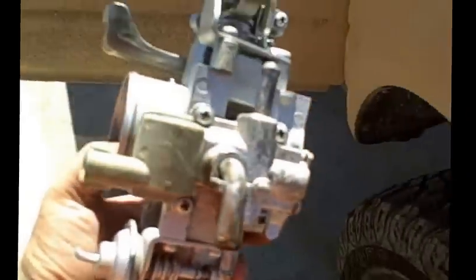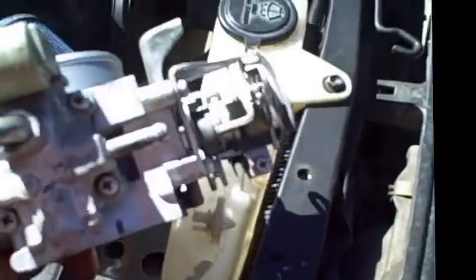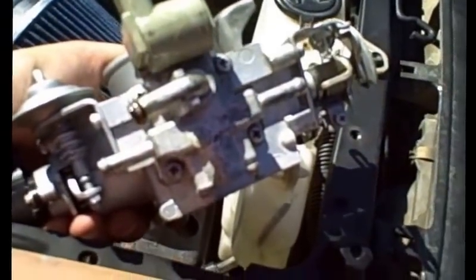I'm cleaning the throttle body. At the bottom you have what's called your IAC, or idle air control. This is very commonly clogged up, and I read a great deal of posts from people who are saying that they have a rough idle or poor gas mileage or just bad air mixture and fuel mixture, and it all comes down to that IAC. Basically, you can see the port on the inside that drips down into that. I don't have it apart, but to clean it, what I recommend is, you'll see those four screws at the very bottom.